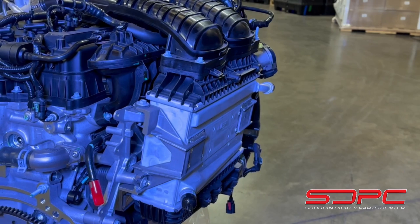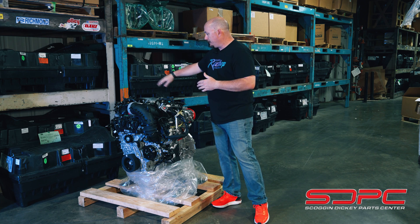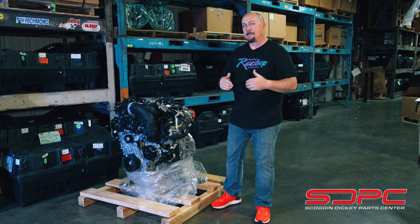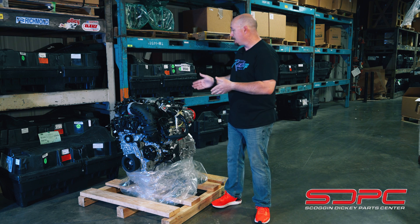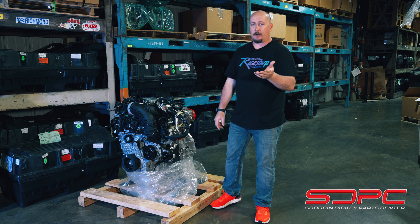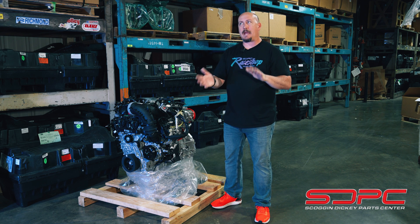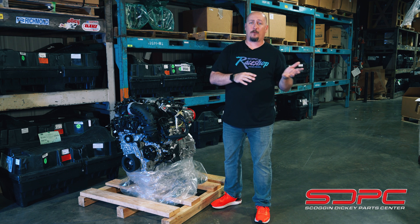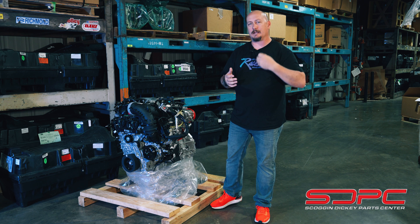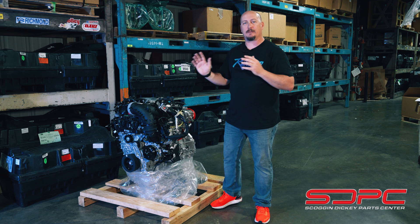These have twin inlets all the way through to a single inlet on the throttle body. The Cat 3 has a larger throttle body than the Cat 1. You could probably add a spacer for secondary port injection on the intake. The Cat 1 and Cat 3 are direct injected. The Cat 3 runs around 100 pounds per hour on the injectors — for reference, an LT4 injector is just over 200 lb/hr. There's headroom in DI fueling, but injector design, body size, and pump size on these engines can be limiting factors.